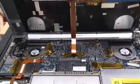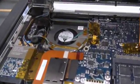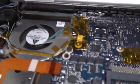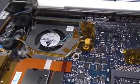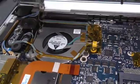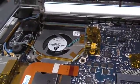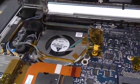I do not recommend doing this — I installed the battery while this thing is open, which is dangerous on a lot of different levels. But I just wanted to show that this is it. I've actually even lifted this fan partially out and had it running. I've tried to use graphite, tried to blow dust out of the thing. I've determined that it's actually the motor itself that's making the noise — there's nothing that's going to fix this thing, which is why I went with the replacement.